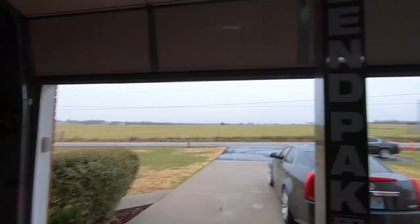When we get a better day we'll take it out and do some testing. Hopefully this addresses the issue - for now I'm just avoiding a full clutch replacement because that is a huge undertaking. The Ranger method of changing the fluid is pretty common, but a couple people were asking where the clutch assist spring was and the process of removing it. It literally takes less than two minutes - it takes me longer to fold up and get under the dash than to remove the spring. I did keep it - don't throw that away if you ever decide to put it back in. It is reversible.